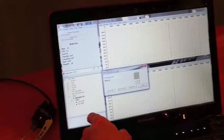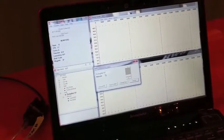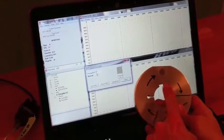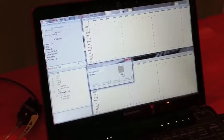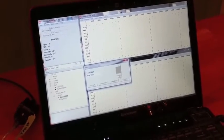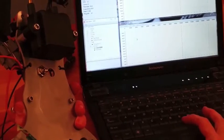The other very important feature is the pickup reference. There is a procedure to measure it — I'll go into that in another video — but for this example, the magnet at this radius is approximately 15 crank degrees wide, so you set that to about 15 degrees and save to MSD. Then down here in the rev limits, you can set your launch limit or overall box rev limit. I set both the launch limit and the max RPM limit to 16,000 RPM and save to MSD.